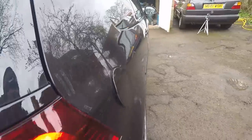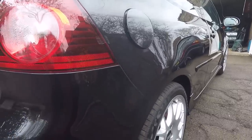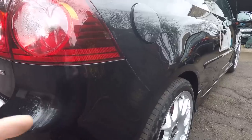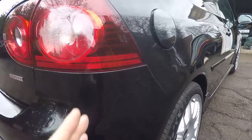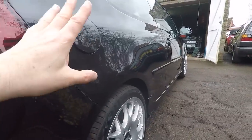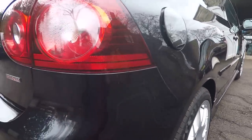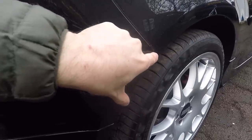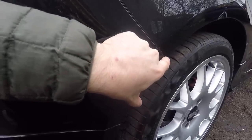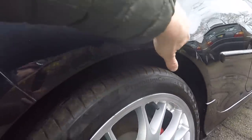Let's move to the quarter panel. This is the angle that you should look at a car from, because it reveals lots of often bad things about cars. We're looking for dents, we're looking for signs of filler, we're also looking at the amount of orange peel, because all mass-produced cars should have orange peel. If they're too smooth, or it's inconsistent, then you know it's been painted. Looking down here, it's pretty good. There's some parking dents in the quarter and the door, but they're manageable — the paintless dent removal guy will get that out, no problem. Always check here on a Mark V where the bumper meets the quarter panel, because the bumper can rub the quarter panel and corrosion sets in. And there is actually a tiny bit there that I can feel. There's a little scratch there on the lip which we can polish out.